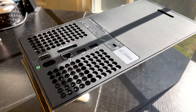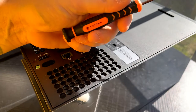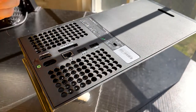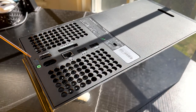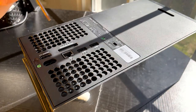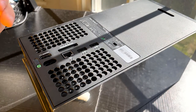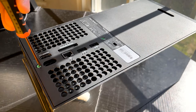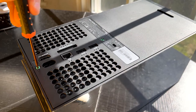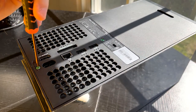To open your Xbox you're going to grab this T8 Torx screwdriver — this is the only tool you're going to need. Now yours will have a sticker covering the screw hole; I've already had LEDs in here once before so mine doesn't. What you're going to do is either peel that sticker back or just shove your screwdriver in right about here and find the threads — just poke a hole in it like I did.